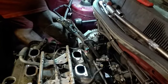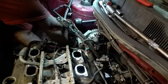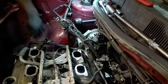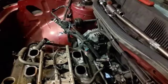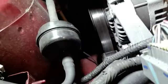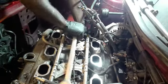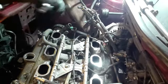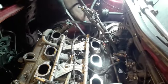Traditionally, in other ways, you're going to have to take the motor mount out. Oh, damn it. I'll have it in there. I can get my wrench down in there and turn it where I need to loosen up the tensioner so I can get plenty of angle on it. Get more leverage if I need to by getting a larger wrench on there and doubling them up, so you get the idea. I really think this is a 14, if I recall correctly, but we're going to find out. There it goes. Got my tensioner loose.